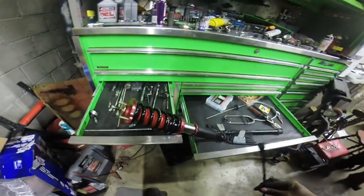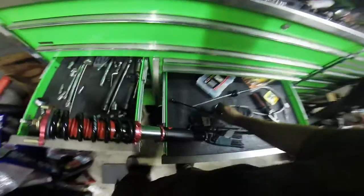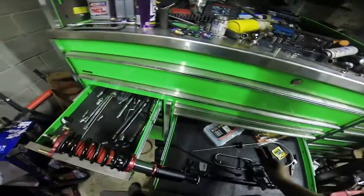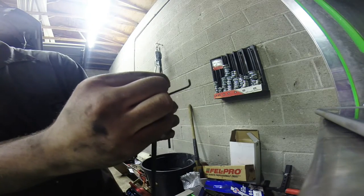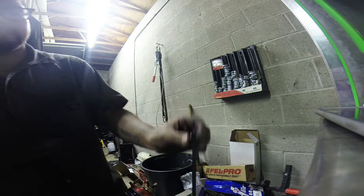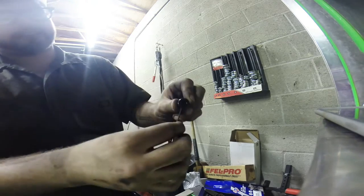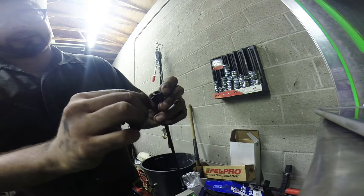We have the rear coilover. This is the tube that we're going to attach to the top of here. In the kit there's a provided allen key, but if you need to know what size it is, it is a 5/64 allen key. Looking at it, we have an allen there that holds the top one — I had to retighten this up, it came off on me already. There's also a bottom one. We loosen the bottom one and this essentially comes out of the middle there. You don't want to take it all the way out.